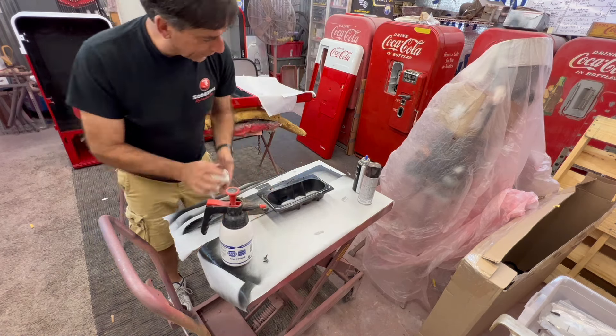That should be good. We'll be shooting the Krylon Fusion — it's called All-in-One, which basically means it's got rust protection, fast drying, works on any surface. Part number 2702. So what's the difference between a primer and an etch? Etch gives it a bite into the product — if you're shooting on bare metal you really need something with etching properties. Once that etch is in, then you put your primer over the top of that. There's a little bit of confusion about what's the difference between an etch and a primer. All right, here we go.